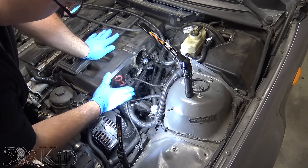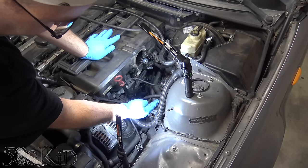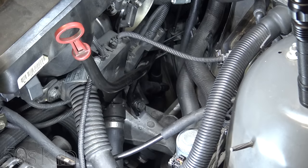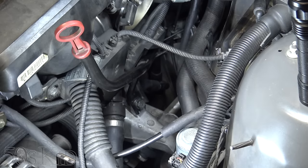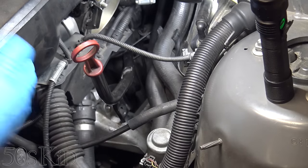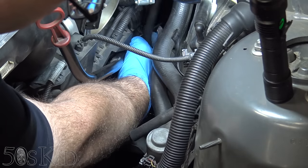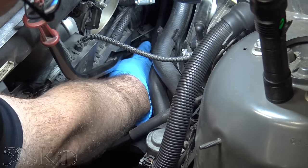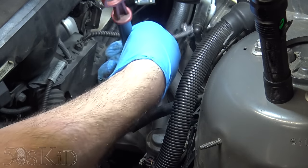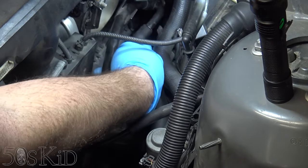Where we need to go from here: we need to remove the dipstick tube, remove this electronics box — unbolt it and move it across to over here — then remove the idle air control valve and the throttle body, and then we'll finally have access to everything we need. Let's start with the oil dipstick tube. There's a 13mm bolt right here that we just need to remove. Pull the dipstick tube out of its holder. Back in here you can see the fuel hose — it's normally clipped into a plastic clip, so you'll have to reach down and undo that little plastic clip. There's also another hard plastic line and clip behind that you'll need to get out, then fish the dipstick tube out from around the fuel hose.